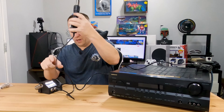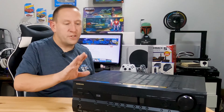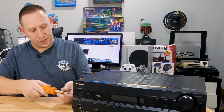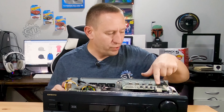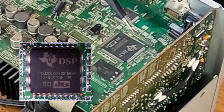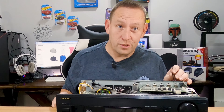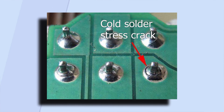I'm going to turn this off because I still need to open up the stereo system. The first thing we need to do is pop the top off — usually there are just a few screws on the side. I did unplug this already. You will want to do the work with it unplugged so you don't short something out. The part we're looking for is right here — this is the Texas Instruments DSP chip. These can get broken; they can get cold solder joints that come apart because they crack over time.